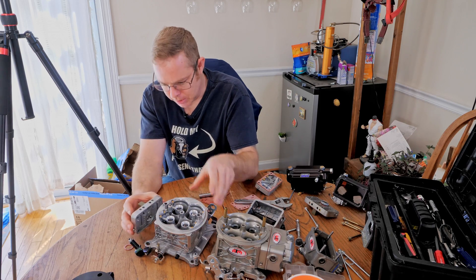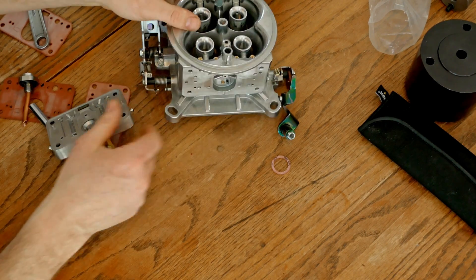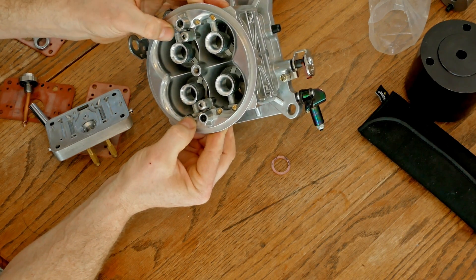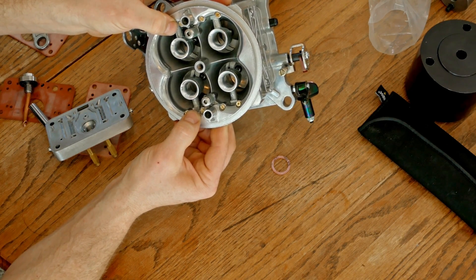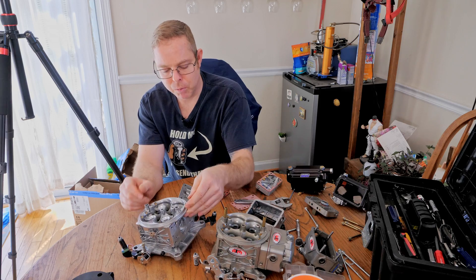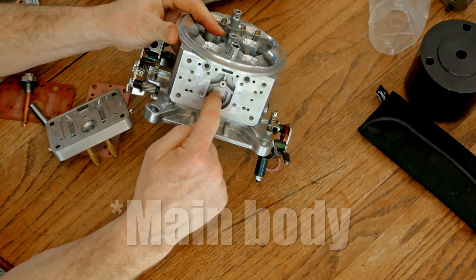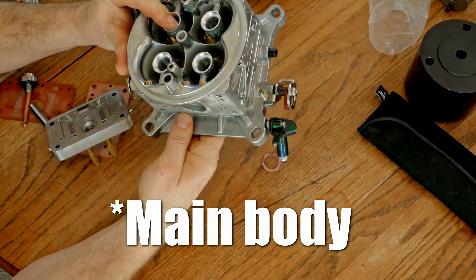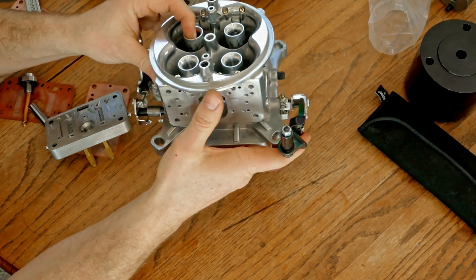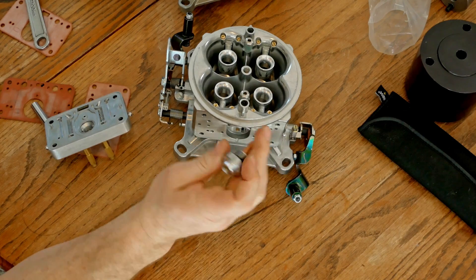You have restrictions in here that adjust your fuel curve. You also have air bleeds up top — the ones here are more for low speed and cruising, and these are your high speed bleeds. The smaller the hole, the less air forced in, which means more fuel. I'm not sure exactly how that'll change the tune-up on a blow-through — we're going to have to figure that out. I've never tuned a blow-through before, but it'll be fun to learn. Also notice in the metering plate this hole is now blocked off — it normally allows vacuum to control enrichment, but we're no longer relying on vacuum. We're using boost with this boost reference power valve instead.